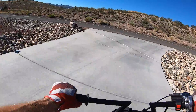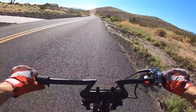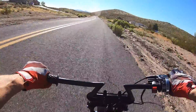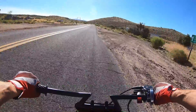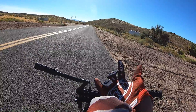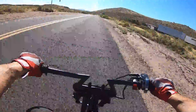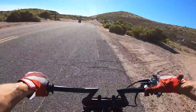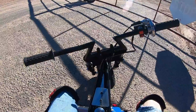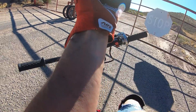A 100 jet — that must have been the stock jet. With the 115 in, it seems better — it doesn't pop or anything so it doesn't seem lean now. Let's do another 0-30. 0-30 with a 115 main jet in the Tilly 212 — seems pretty good. The result: 4.10, still similar in 0-30. But we'll see what top speed is — so far we did 46.48, so we'll see if we can beat that.